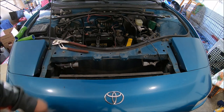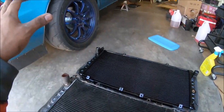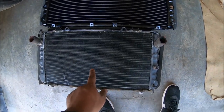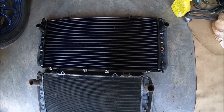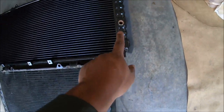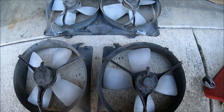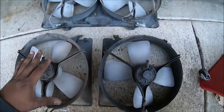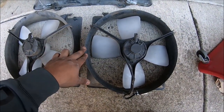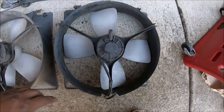I'm going to compare the differences between the NA radiator — my car is an NA chassis — versus the turbo radiator. The main difference is that the NA radiator is considerably smaller than the turbo radiator. Everything else is pretty much the same, like sensor spots. If you have an NA radiator and switch to a turbo radiator you're going to need different fans — the turbo radiator fans are slightly bigger and the mounting points are at different positions to accommodate the bigger size.